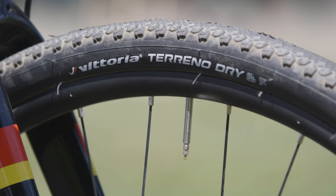Diving into the components, there was an issue with the tires. When getting all these bikes ready before arriving, they were working to set all the bikes up tubeless — but this bike still has tubes because the tires are not tubeless-ready. This is one of the only few bikes at this price point that didn't come with a tubeless-ready tire. You can convert the rim to tubeless, not super easily — you need rim tape, it doesn't have the best tubeless profile — but it can be done. However, you'll need to buy new tires, rim tape, valves, and sealant. The cheapest you're going to get into that is about $130, assuming you do it yourself.